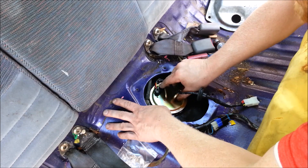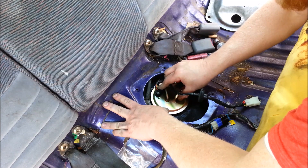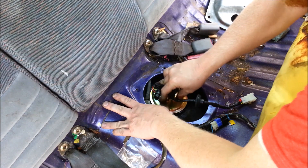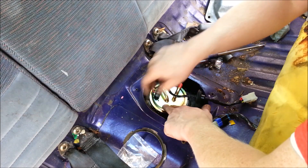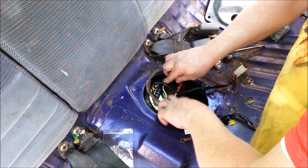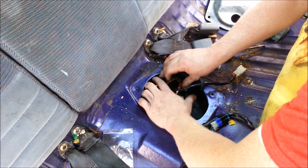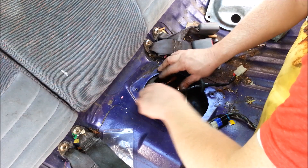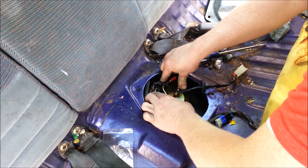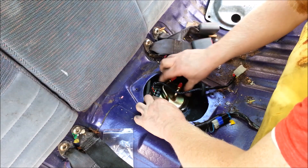The hardest part about this job is if you do have to drop the fuel tank. It's not the hardest thing in the world, but it does increase the difficulty quite a bit if the fuel tank has a lot of gas in it, because of the weight — each gallon of gas weighs around six or seven pounds. With a 10-gallon tank, that's an extra 60 to 70 pounds on top of you.